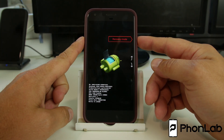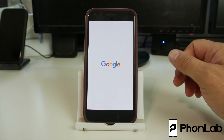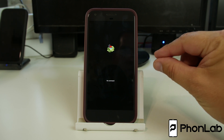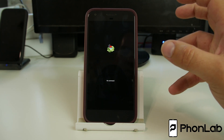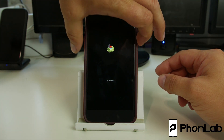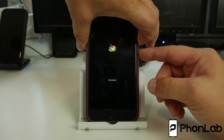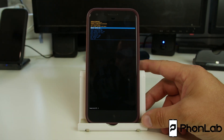We're going to go to recovery mode as our next boot mode. Once you boot to recovery, you're going to see there's this dead Android guy right here, and it says 'No Commands.' This is what's called the splash screen of recovery, not the recovery menu. To get to recovery from here, you're going to hold down the power button for three seconds — one, two, three — and then tap the volume up button. This gets you into recovery mode.